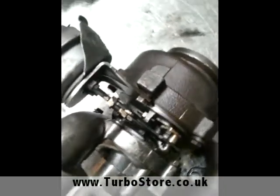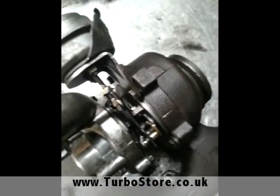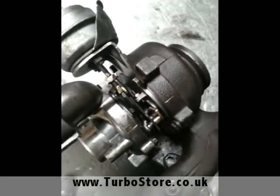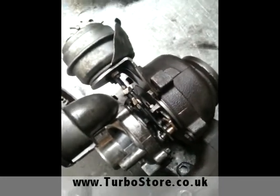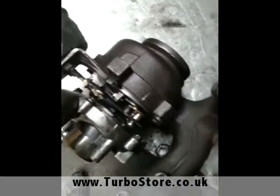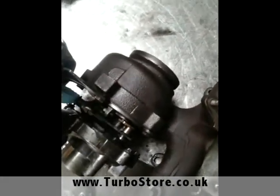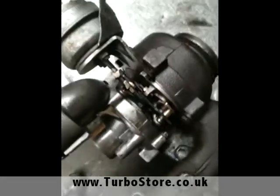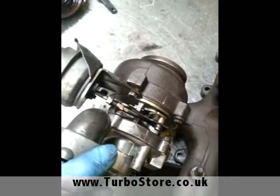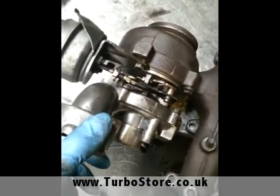That's it bolted back together — one core fitted to the casing. Remember, if you're fitting a new core and new vanes, those products are generally made brand new in a factory, so it's the best way to repair or recondition your own turbocharger without buying a complete turbocharger online from various websites. As we said, there's nothing in the casing once you unbolt the core and the vanes — they're just empty housings. The moving parts are the core and the variable vanes, so if you replace those you've replaced everything that moves inside your turbocharger. Fit it back to the engine, do a good engine flush and good quality oil and filter change, and it should be good to go. Thanks for watching this video and I hope it was useful.